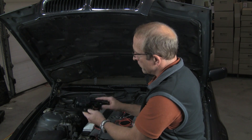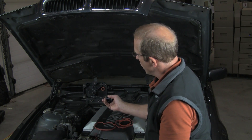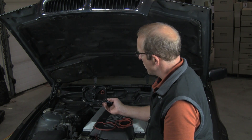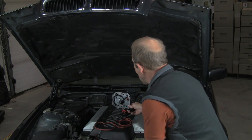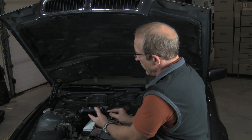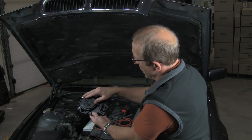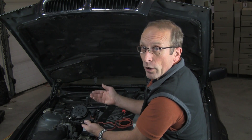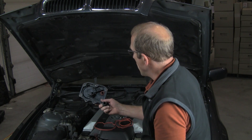This is the check valve. It mounts to the manifold in this position. This is the inside of the valve inside the intake manifold — it actually mounts on the back of the intake manifold under this cover back here. There's a rubber diaphragm here which ruptures, and that will cause vacuum leaks and oil burning. We'll show you how to replace this.